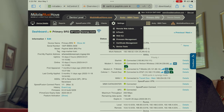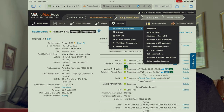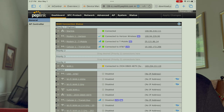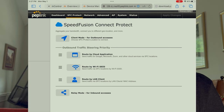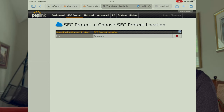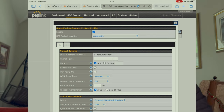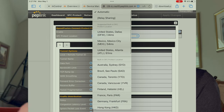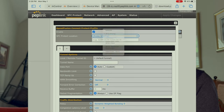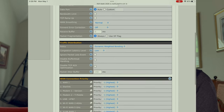Now we're going to go back to InControl and remote into our primary device — for me this is a BR2, but again, Transit, BR1 Pro, whatever you're using. We're going to do the same steps: remote in, go to the SpeedFusion Connect Protect tab. In a different spot, we're actually looking for outbound here — the last one was inbound, this one's going to be outbound. Once you've clicked into outbound, we're going to select the existing profile — you might have to create a new one. Select on the name and then change 'automatic' to 'sharing relay,' which is the second option. Once you select this, you'll see an option to drop in the sharing code and then hit save.